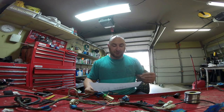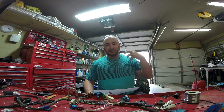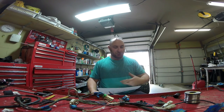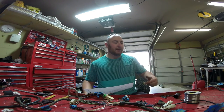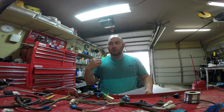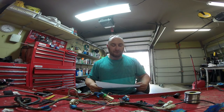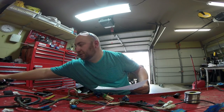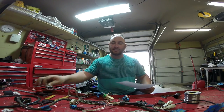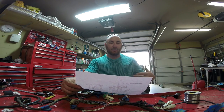We're also going to extend the whole harness from the key assembly — it basically just needs about three feet of additional wiring to run it back to the harness. We're going to jumper the engine stop — that's the safety switch on the handlebar — since our golf cart doesn't need it and there's nowhere convenient to put one. We'll use a single pole dual throw switch to run our headlights instead of the little slider it used to have. And having the wiring diagram helps you see exactly what you need to do.